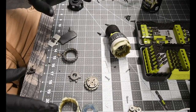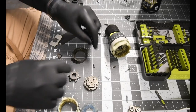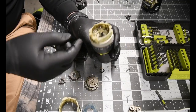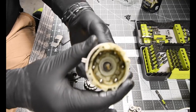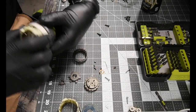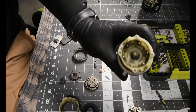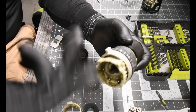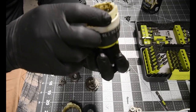The odds of me putting this together just went down to nothing. I think those are just the rods. So yeah, then the gears eventually just spin this, and then that spins the chuck. And the clutch is just a stopper for a certain amount of tension on here, and then it just skips the gears so you don't strip the screw.